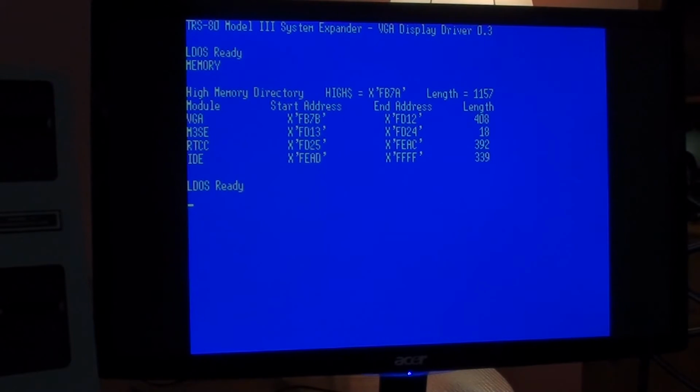The reason for the 80 column mode is that this was primarily developed for use with the Telnet client that comes with Miis, and if you use that client to connect to Telnet servers out on the internet, they normally expect 80 columns as a minimum for the display device. If you tell them you have 64 columns, things sometimes wrap around and don't really look quite right.